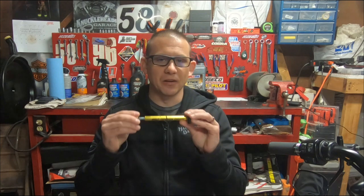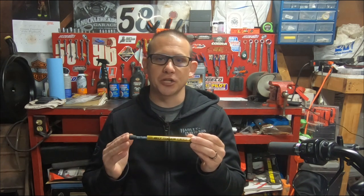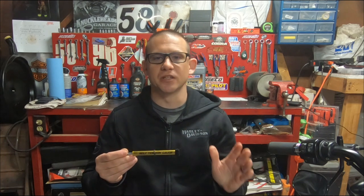What you're going to have to do is rely on either measuring it out yourself from a fixed point on the motorcycle to the axle, or use one of a couple of tools that are really helpful for making sure you have your belt or chain straight. For the belt, a belt tension gauge is great. A lot of guys can tension them by feel, but I always check it to make sure it's correct because tension is very, very important. The best place to reference factory belt information is right here in the owner's manual — you'll find everything you need on how to properly tension and maintain your belt.